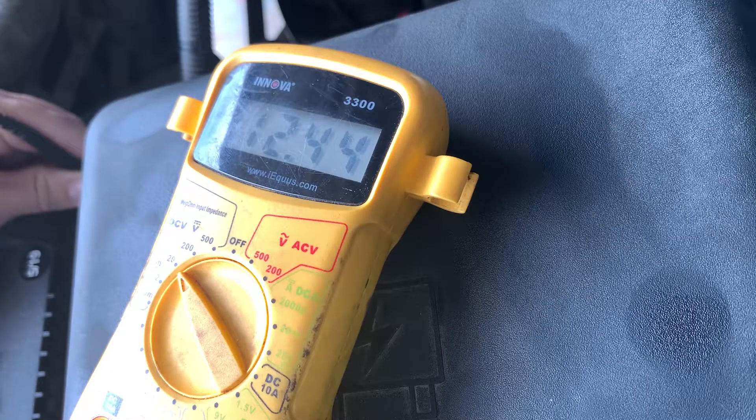The reason I'm doing this is because I'm working on figuring out why the alternator is whining so much. I've got a real bad whine in my alternator, and I think it's because it's under load. One potential reason could be that it is trying to charge this half-charged battery. And an alternator is not really a battery charger — it's more of a battery maintainer. Keep that in mind.